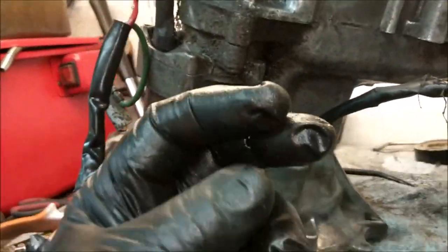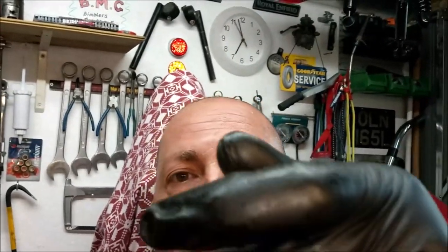Right, anyway guys, a Bendix gear is basically, you've got your motor and then you've got your spigot drive off the motor. And when you fire the starter motor, there's a spring on the end, a circlip spring, and then the gear. And centrifugal force throws the gear into the flywheel, the gearing. It engages the flywheel, turns the engine over, and then when you take your finger off the starter motor, the spring pushes the gear back out of line of the flywheel. Otherwise, the starter motor will constantly be engaged. So that's a Bendix.